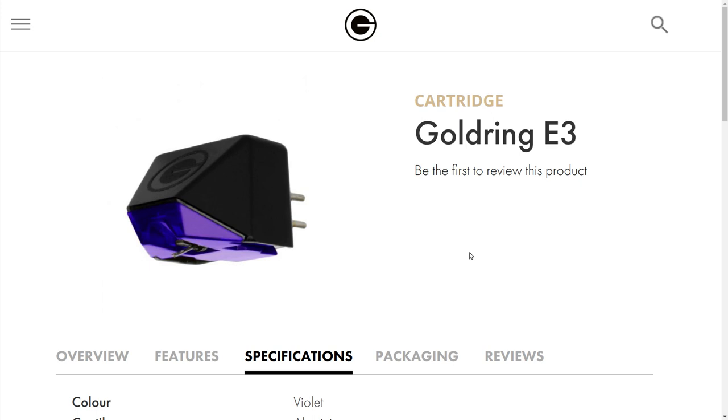Whereas this is $150 and fits in real nice. It's great if you're just starting out or have a secondary turntable that needs a new cartridge. If you're not confident about mounting a cartridge, this is super easy — there are no nuts and bolts, you just put it on the headshell, screw it down, take your alignment protractor, and it's got nice square sides and edges. This thing is super easy to align, you can see the stylus clearly. I am just super impressed with it and can't find much negative to say.